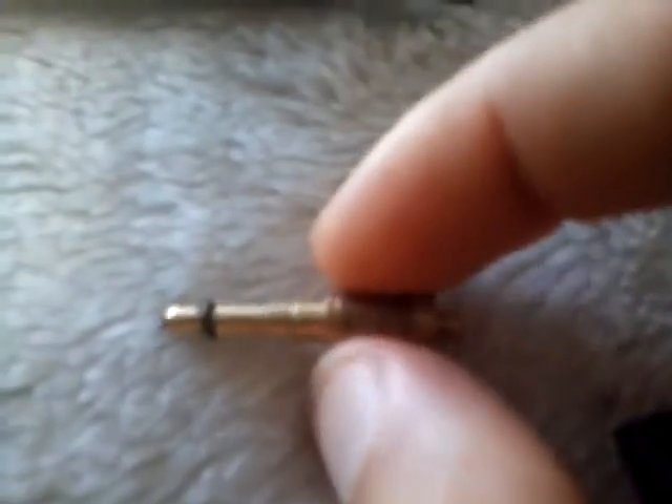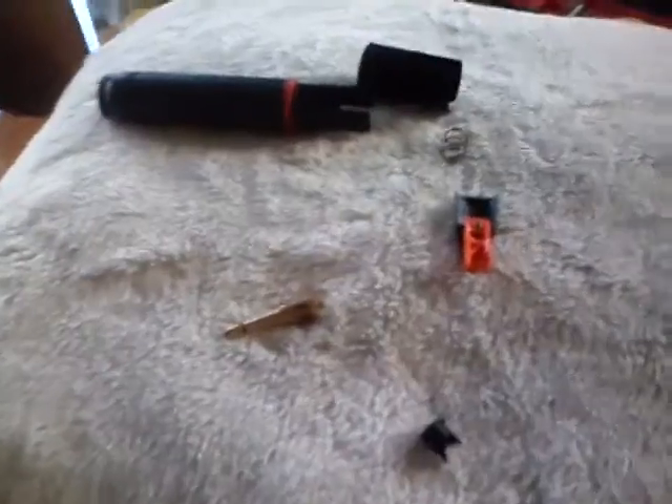In here we have this mechanism and gas comes through an itty bitty little hole — right here. It can't get around the o-ring so it goes up through here and through a jet, probably mixes with some air, and then out through this tube. This tube is actually made of three pieces of metal, pressure fitted together. I've been trying to clean out this jet — I've tried compressed air, I've tried vinegar, I haven't tried CLR. I'm cooking the jet. I tried blasting compressed air down here and it kind of worked for a little bit, but then it locked up again.